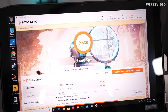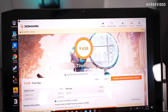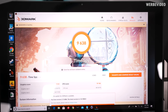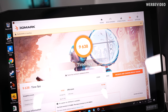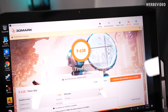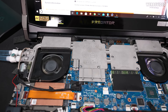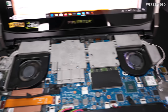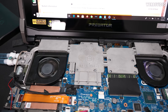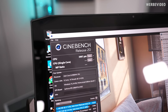Finally we have the result we were looking for: 9600 points versus the previous 9000 points stock — a performance increase of about 8%. That's a solid improvement especially considering we can't overclock these mobile GPUs; NVIDIA hard locks the power limits. It was just the thermal paste application on the GPU and the pads around it not having proper contact. Running Cinebench again to verify CPU contact — still around 4000 points, so the CPU was fine before and I don't need to rerun all the tests.